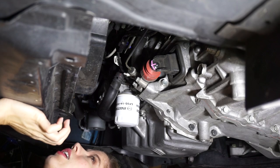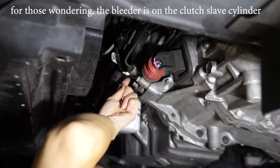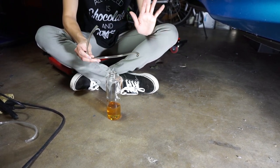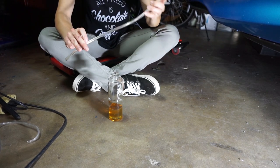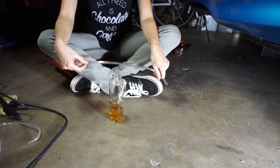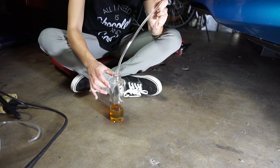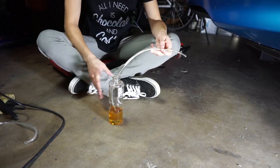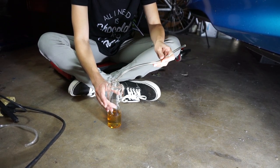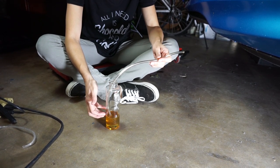Now we're under the car and have removed the under tray. You're going to want to locate your transmission and find a little bleeder valve on it — it's usually connected to a steel line. Now that we've located the bleeder valve, we can set up the process to bleed it. Get a clear tube like we showed you in the beginning, attach it to the end of that valve, and then put the other end into a clear bottle with a little bit of new fluid in it. The reason you want new fluid at the bottom of the container is that just in case anything gets sucked back up during the bleeding process, you don't want air to get sucked back up — it's just a contingency.